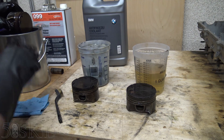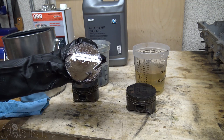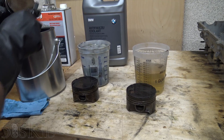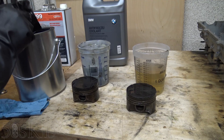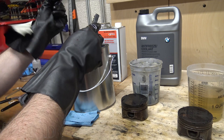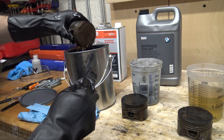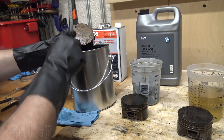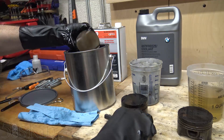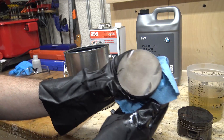Let's go ahead and check the one that probably did work. And you can see that that definitely did work. Let me just give that a little scrub with the brass brush to get the solids moving — just a little run around the edges here. You can see that it's just taking that stuff off. Give it a rinse — you can see most of it's coming clean. You just spend a little bit of time with the brush, give it a wipe, and you can get your pistons pretty clean.